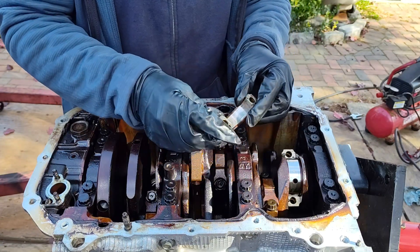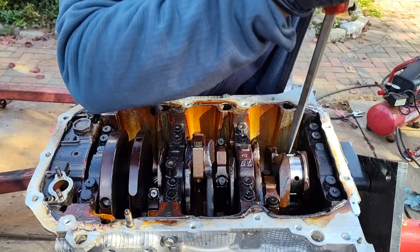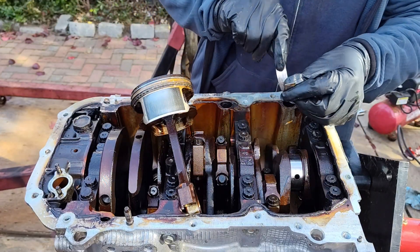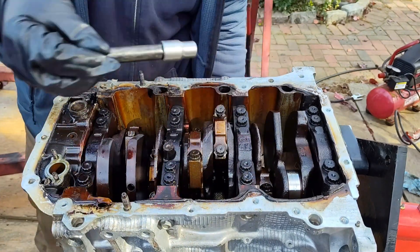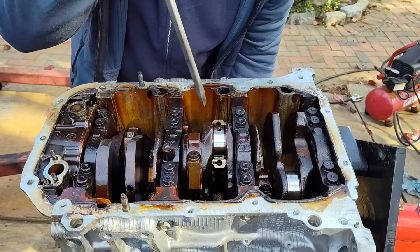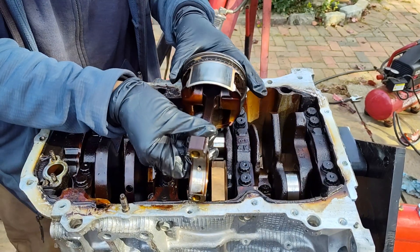I'm going to be inspecting all of these components later on. When you're pushing down the piston with a flathead screwdriver or whatever you're using, just make sure you put the tip of the screwdriver as far as you can from the cylinder wall so you don't scratch it — because if the cylinder wall is damaged, then the engine might be useless. Got the first piston out and I'm putting them in order to be inspected later on. The other bearing also stayed inside, so they might have some wear already. I'm going to continue pulling out all of the pistons the same way. Another bearing that stayed inside — it didn't stick with the connecting rod bearing cap. When pushing down the pistons, do this very carefully — be careful not to scratch the cylinder walls, otherwise the engine is going to be messed up. Another piston here and this one came out with a bearing — that is very good.